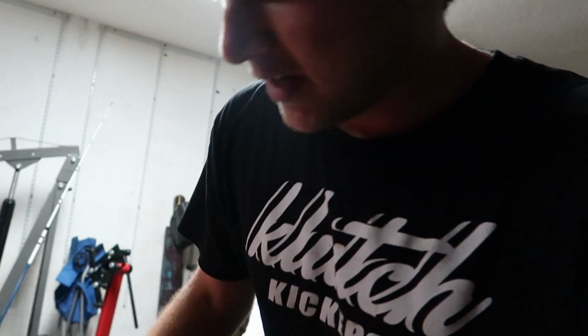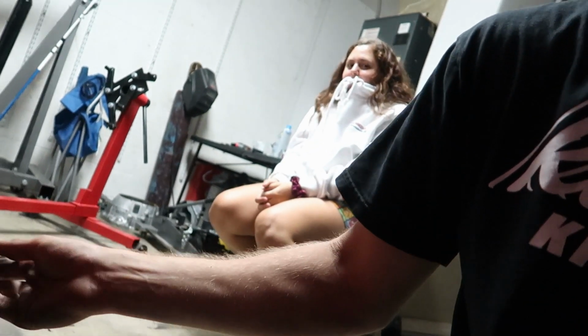And then we've got to bleed the clutch. We had a vacuum bleeder, which would pump fluid in there so it's not dry when you do it, but it's not working. It's a GM bleeder fitting, and it's huge. Anyway, it's not working because this right here is too small to go on the thingy. So we're just gonna send it, hopefully. We're not gonna fully push the clutch in, we're gonna go 5% and then slowly work our way up so it doesn't bleed while it's dry.